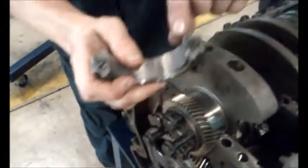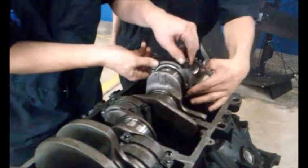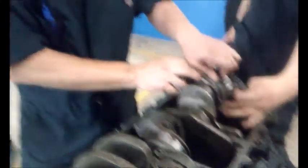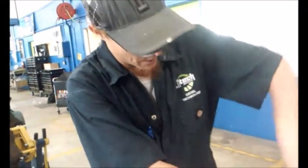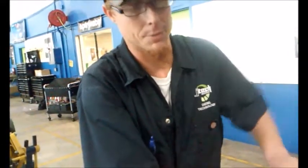Taking my cap here, right here on the bearing sleeves you see your grooves — you want to match your grooves up like so whenever reassembling. Hand tighten the bolts first, that way you do not try wrenching them down and strip them out, because that is an expensive fix.